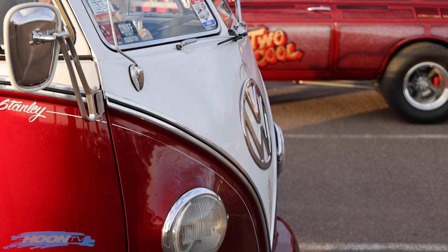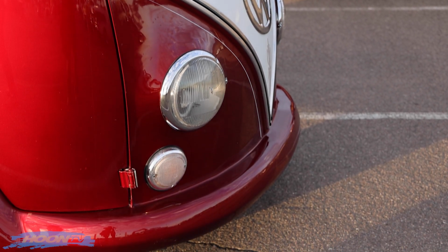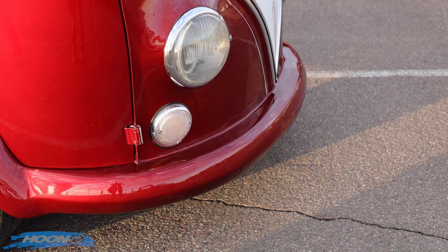It is a 2180cc Volkswagen air-cooled. Yep. It's a pretty old school style build, real kind of mellow, more for torque and to keep up with modern traffic. And I heard out of the corner of my ear before, a weird expression, but it's been down the drag strip? Yes, it has. It's not fast, but it has pulled the front wheels at the drag strip and at Bandimere, which is 5,600 feet in elevation, it runs 17 O's, which isn't, you know, killer fast, but modern car equivalent. Yeah, exactly. That's awesome.